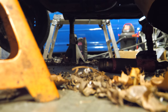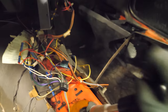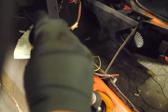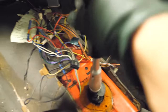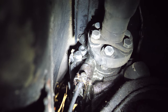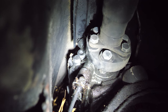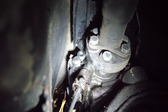Let's see how it shifts. It's still like 50 miles of slop but it's down from 80. You could drive it. One of the mounts for the shifter base is broken and ripped, so I'm going to take this apart and see if I can get a washer in there to make it a little better. I don't think it's ever going to be right unless I replace the shifter base, but we'll try.